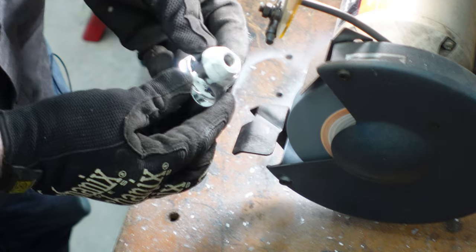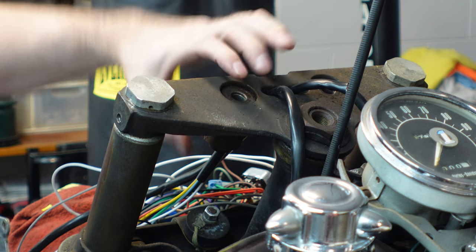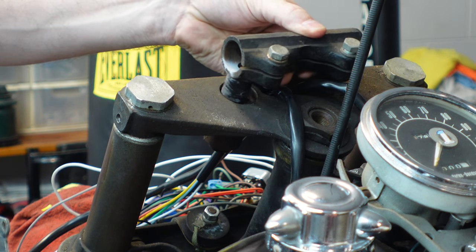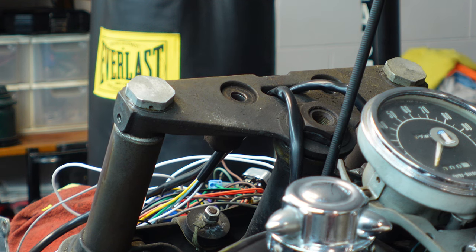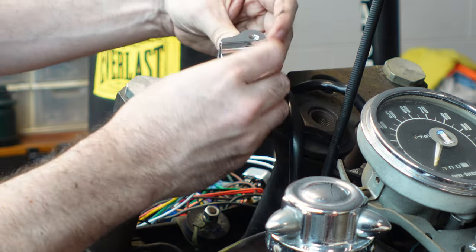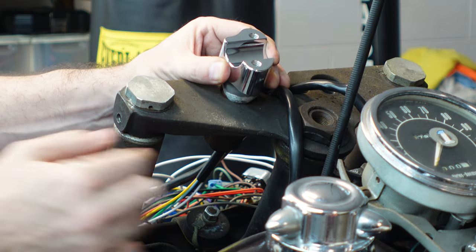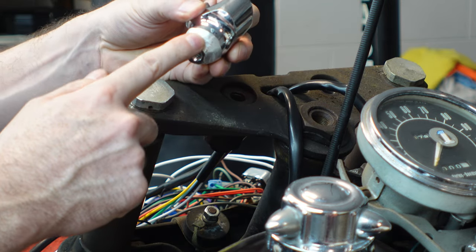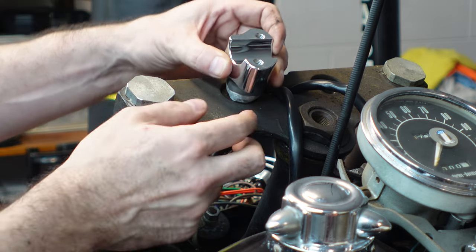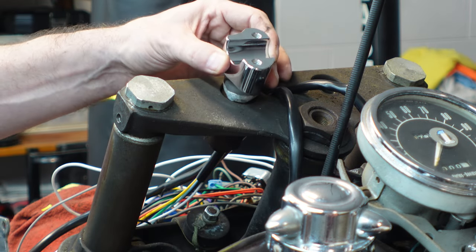I think that'll do it. Back over at the bike now. You can see this is inset a little bit — there's a washer and a bushing down in there and it gets bolted down on top of the fork. Here is the original part; you can see how thin it is and how it sits down in there with plenty of room. Now that we've tapered the new aftermarket part, it sits down in there fine. So this is going to be mounted and bolted down here. The handlebar will lay in the groove, then there'll be a cap and a cover that goes on top. For those saying I'm tearing up the chrome — it's going to be sunk down in there, not really visible. I just wanted the one-piece handlebar, and this is the best way I can do it.